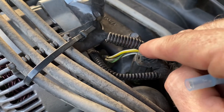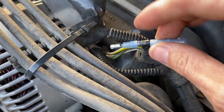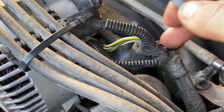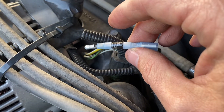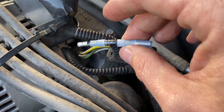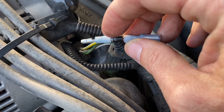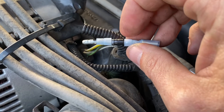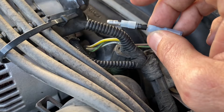What you do is cut the wire in half somewhere — put a female connector on one end, a male connector on the other. Once you've got your connectors, this diode goes right in line. I'll have the wire with the female connector plugged into one end, and the wire with the male connector plugged into the other. If you want more voltage, add another diode in line. Make sure the silver stripe always faces the alternator, and put some heat shrink on it or wrap it to keep it from burning and prevent any metal-to-metal contact.